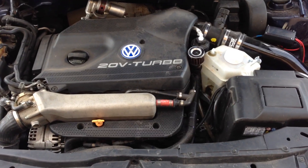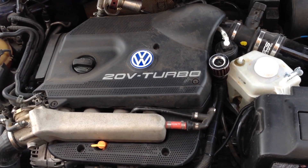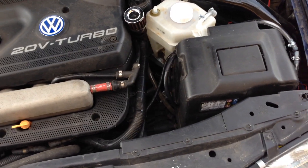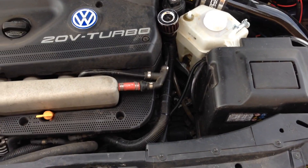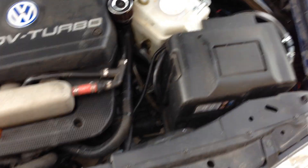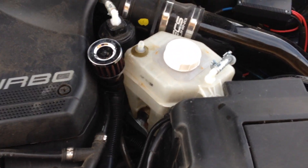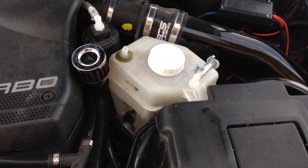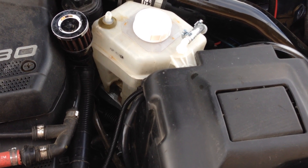The only way I could monitor the amps it was pulling — I have a meter in the car now — but the only way I could control the amps was by adjusting the mixture level. But with that mixture level, it wasn't a high enough concentration of KOH to protect it during the winter, so it would have been freezing. So what I did was make a really potent mix of KOH and distilled water — somewhere around 32 tablespoons in one gallon. I had to keep upping it until it would stop freezing.